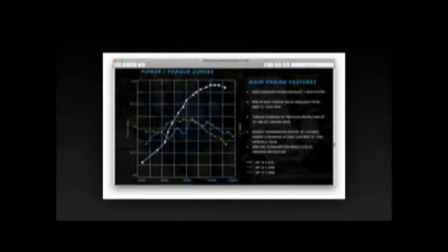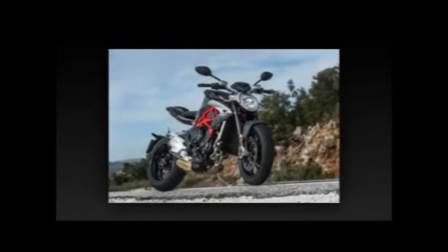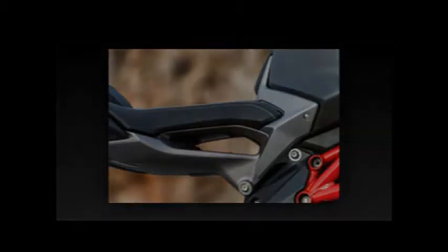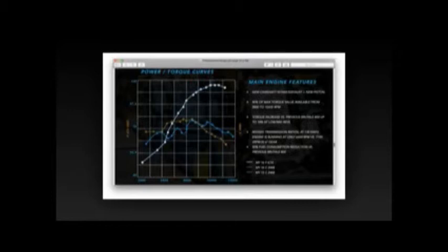And maybe also some things that will cause you to tear your hair out that only an owner gets to discover. Along with Euro 4 comes mandatory OBD, should any actual mechanical malady develop. There is DLC coating on the starter clutch now for reduced friction, which we surmise may have been causing trouble before. Sweaty details: this little alloy plate that protects the right blinker from exhaust blast, with just the right lip to keep soot from collecting on the lens, took many hours to design.